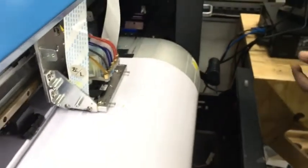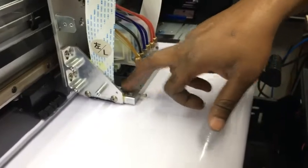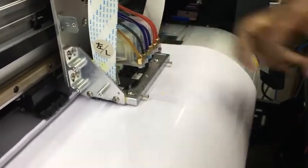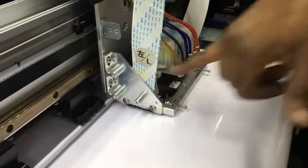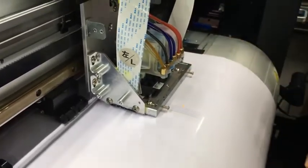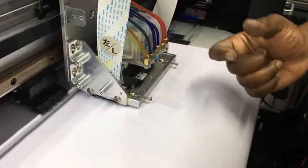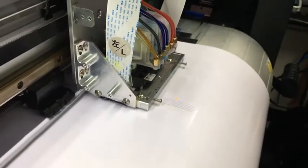In the event that the lines are not straight, what you have to do is adjust this manually. If you look on your head, there are one, two, three, and four screws there. The first thing you do is unscrew these lightly — not too much, because you don't want the head to be moving loose in there.